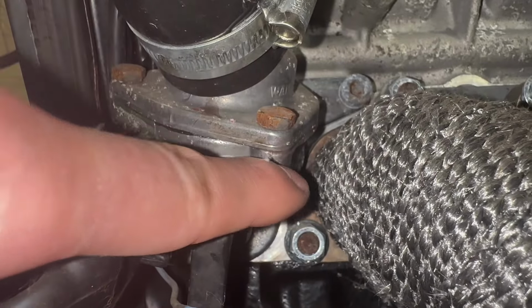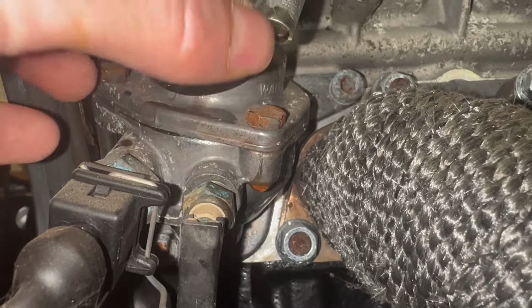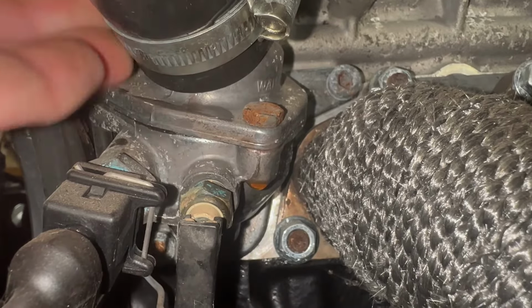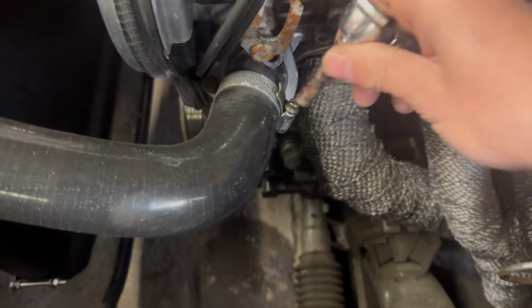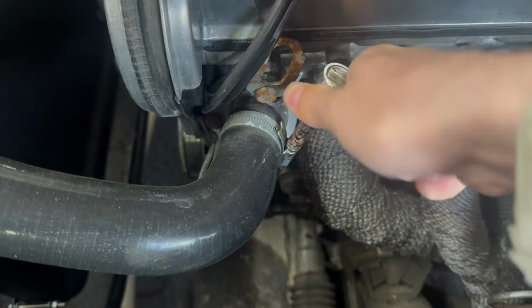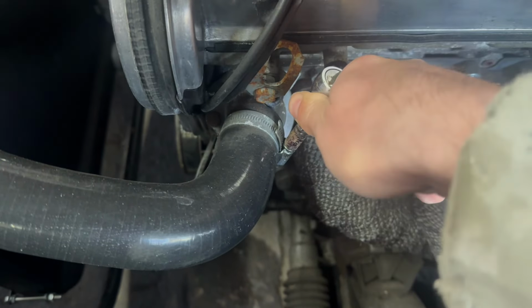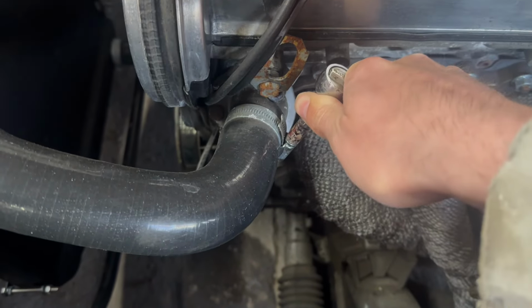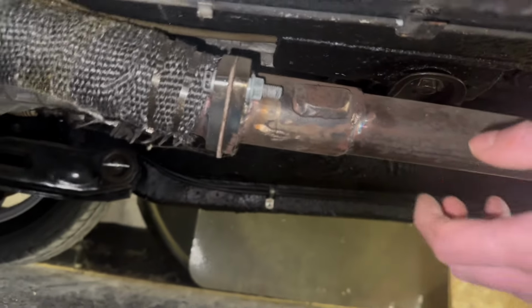It's here. It's coming out the thermostat, but it actually looks like it's probably coming out the hose, out the jubilee clip. So I can tighten that up. No bother, I'll sort that later. I'm not sorting it later, I'll sort it now. If it's just coming out of that, let's tighten it now before I forget. Click, click, click. Okay, back to what we were doing anyway.